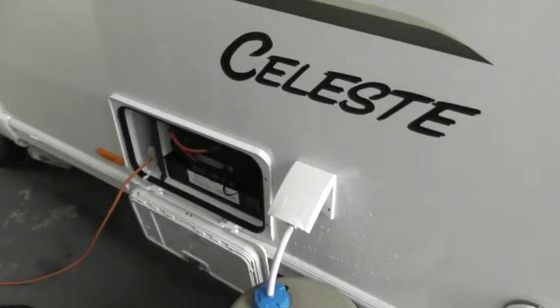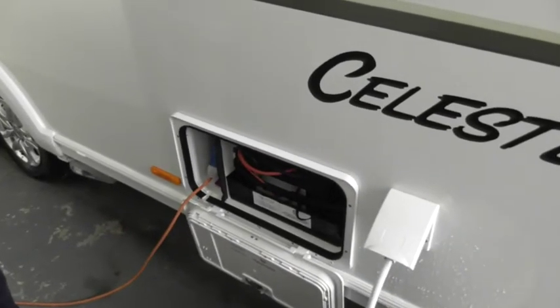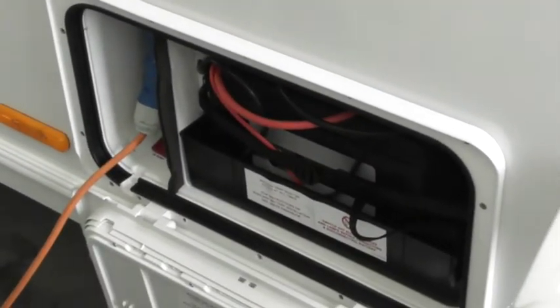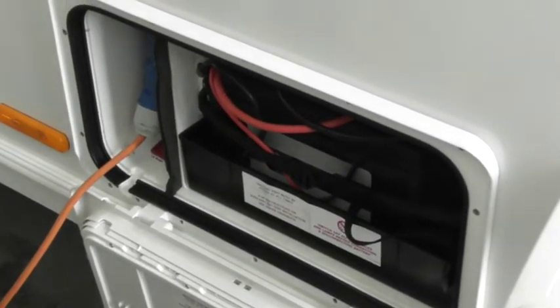Battery — you've got your battery fitted. Two-forty connection. Obviously always connect to your van first, fully unravel the cable, connect to your bollard. Don't do it the other way round — connect to bollard, cable across wet grass, you've got power already there. Obviously a bit of a risk of electrocution. Two-forty.